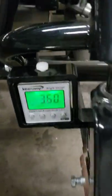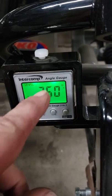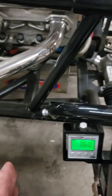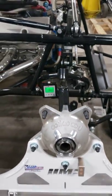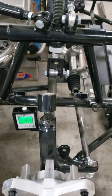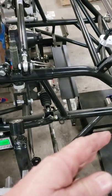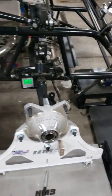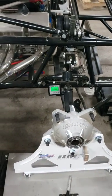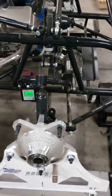Caster. Get the car in dynamic attitude. Caster is at 3.6 degrees positive. How you can tell it's positive is you see that little arrow up — that means it is in a positive state. Also, positive caster means the upper ball joint is behind the lower ball joint. And as you can see the tilt in the spindle. Now, what you have to be really careful about is if you've got a strut front end, don't over-lengthen or shorten your strut rod to achieve your caster, because that will really play with wheel location and either move the wheel further forward or further back, changing the handling characteristics of the car. So do it mainly with the upper A-frames.